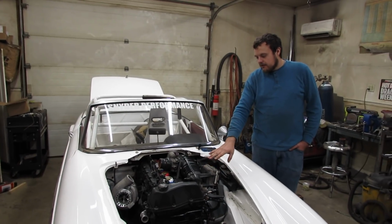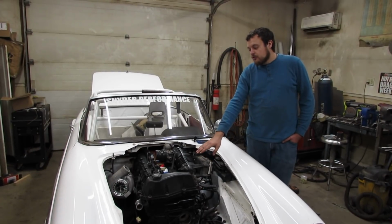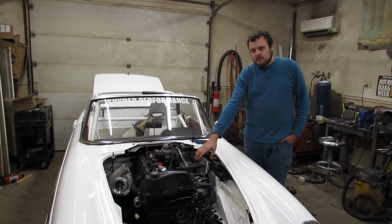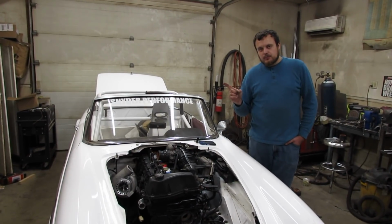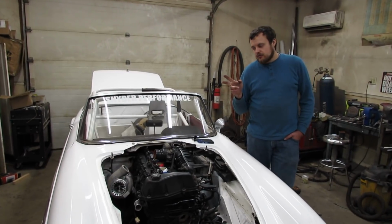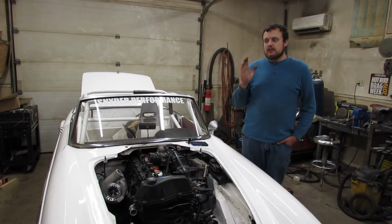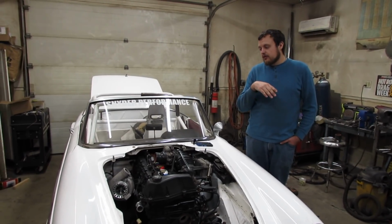The only thing that he didn't really talk about in his video when he started putting boost to the engine was, did it like a different angle? I think he may have said that it still liked the same angle, but the thing is, one, he wasn't running very much boost, and two, he was running a GT45. So a GT45, they are notoriously compressor limited, meaning you will reach the limits of compressor flow before you will reach the limits of the exhaust flow.